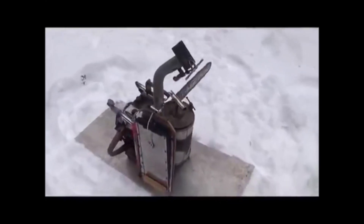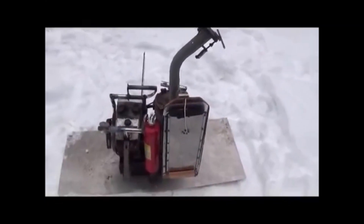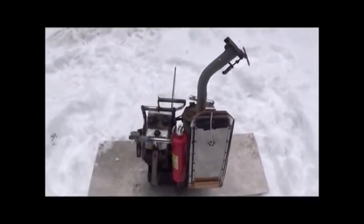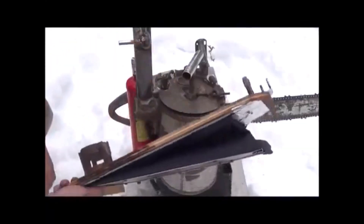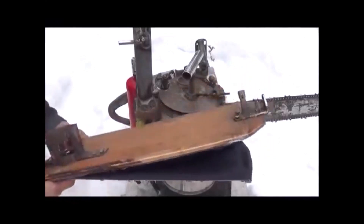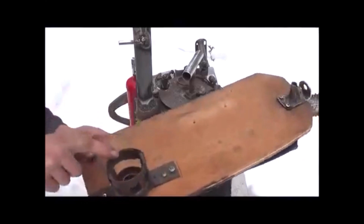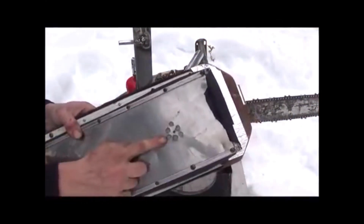That's the entire system sitting on an aluminum plate. That nice shiny plate you see right here — that's our bellow system. It's a big bellow, it's kind of collapsed right now. That allows us to get the gasifier up into temperature very, very fast. You can see here how it clamps on, you can see some of the air hole draw around there, the actual air input into the system, and it's got the air draw into the bellow right here.